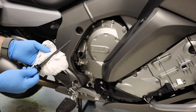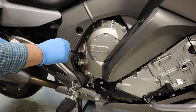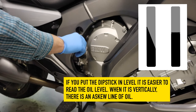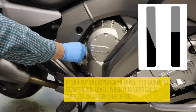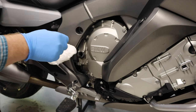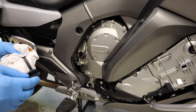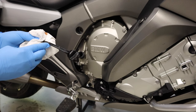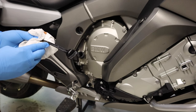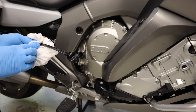The next point is: seat the oil dipstick on the oil filler neck but do not engage the threads — like that. Then the last point is: remove the oil dipstick and check the oil level. And when I'm looking at this oil level here on the dipstick, it's just below the middle mark — or there's no actual mark, just the midpoint between the maximum and minimum marks.